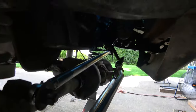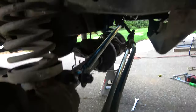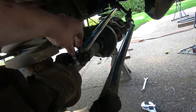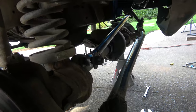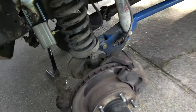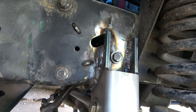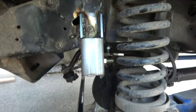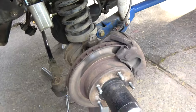Alright guys, we're pretty much installed here. We've got the ends all welded up. Everything is loose on the ends still — I'm going to do a final adjustment in a bit. I think the axle's still fairly centered. I've got to tighten everything up with the cotter pin. Before I do all that I'm going to paint it, because if I don't do it now I never will. We've got plenty of weld going on there — not the prettiest, but it doesn't flex at all. We just turned the steering wheel and it's pretty stiff now. The steering is considerably stiffer.